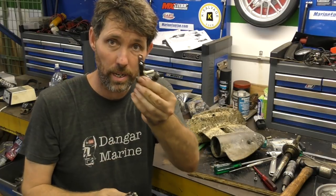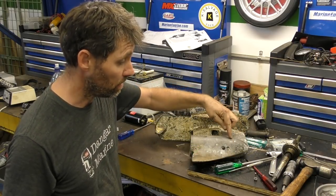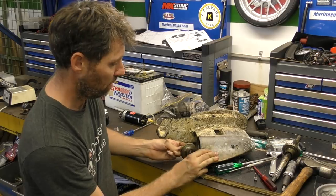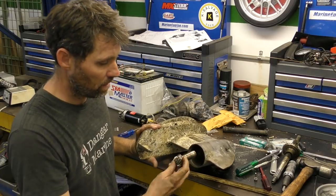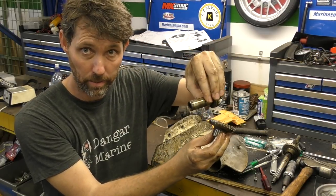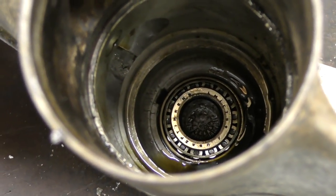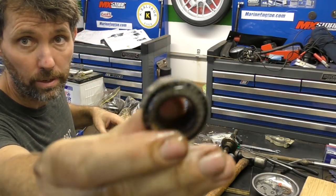Then I'm able to fish out the dog clutch and the shift lever. Sitting at the back of the gearbox is the forward gear — if I reach in, I can tilt the bottom of it under the pinion gear and pull that out. With that forward gear out, the pinion gear can drop down and then that can come out too. I pulled the forward gear out and under, which let the pinion gear drop and come out as well. Down in the back there, you'll see there's a taper roller bearing for the front end of the prop shaft. The bearing will fall out but the race will be quite firmly in there, so I'll just get the bearing out for now — just a standard taper roller bearing.